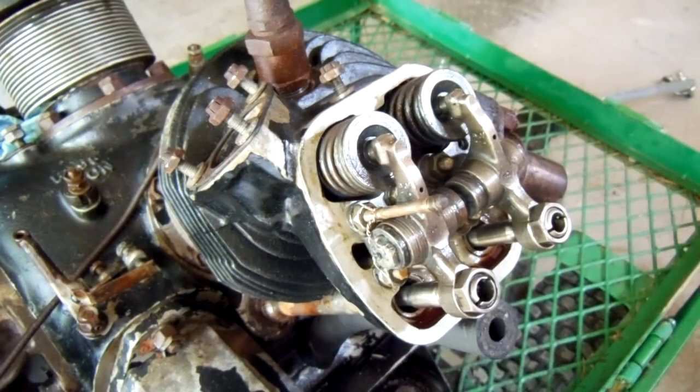So now that we've identified the issue, let's talk about how to fix it. The first thing we want to do is check the valve clearance, and this is important because valve clearance establishes valve timing. With an incorrect clearance, you can have valves opening and closing earlier or later than they're supposed to, and this can cause all kinds of problems, such as backfiring if the intake valve is opening too early. I actually discovered that someone had been monkeying around with the intake valve clearance on the number one cylinder on this engine, and they had the adjusting screw turned in so far that it was almost to the point of preventing the valve from fully closing. So checking the clearance is definitely the first thing you want to do here.